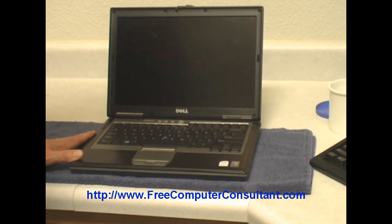This unit started to make a clinking noise a couple of days ago, and the thing to do when that happens is to immediately back up your data. Anything that's important to you — don't shut off the machine. Take a USB stick or USB drive, plug it in, connect it to a network, whatever you need to do — get anything important off of that machine. Because the following day, the machine booted up and we got an internal hard drive error. It would not read the drive at all. So we need to replace the drive, and Dell will happily ship us a new drive, but depending upon what kind of warranty service you have, you may or may not get a technician provided to change that for you. So I want to show you how easy it is to actually change the drive.